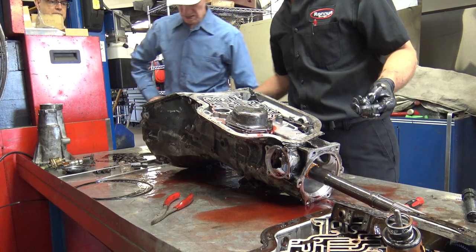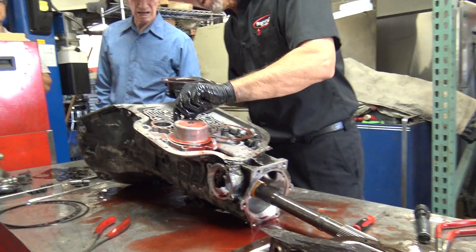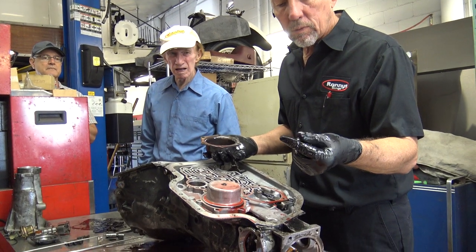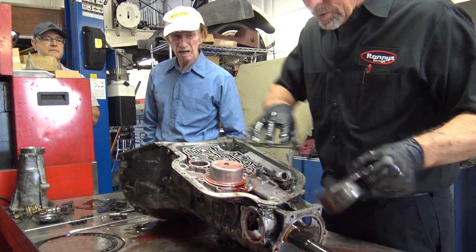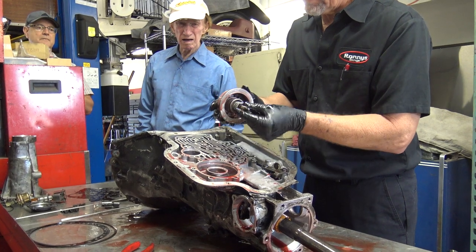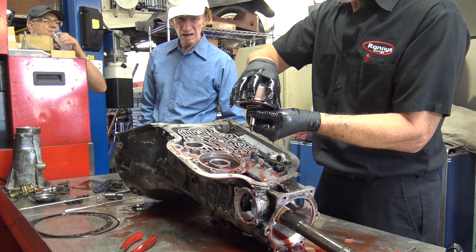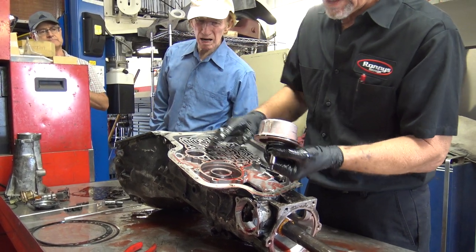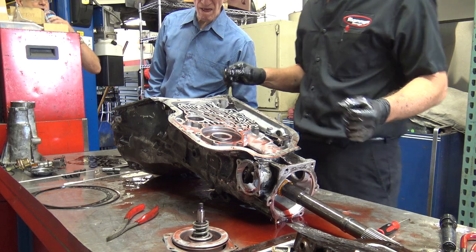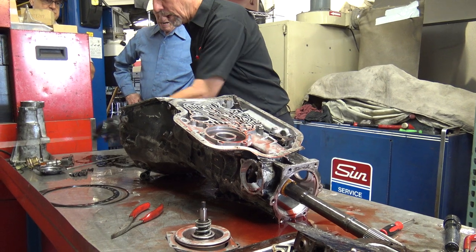Look at that — you can see the little piece of rubber, that's the seal. The housing that holds that is also spring-loaded and has some accumulator pistons. As you can see, this one has a much wider circumference, so it has to apply more pressure to that rear band. It's much stouter, and I think that's for first and reverse — but I'm always welcome to be corrected.